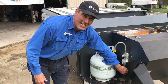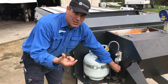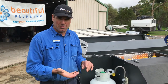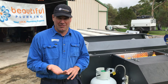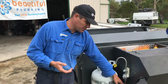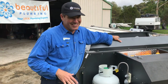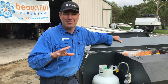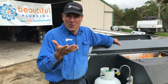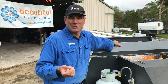Also, this is the smallest gas pipe, so we're going to enlarge it just to cope with the extra megajoule ratings from the new appliances, because we're going to put a bayonet in for the barbecue and the hot plate. The easiest option was just to run it across the top of the camper willy-nilly — but no, totally, I wouldn't do that. Even if you paid me, I wouldn't do that. Well, maybe — if you really wanted it done and paid a bit of money, we could discuss it anyway.